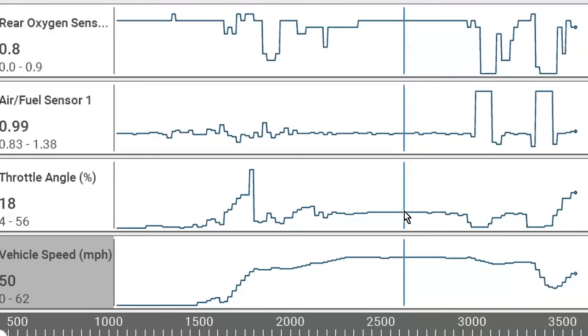So this 18% throttle angle, that is not accelerator pedal, that is throttle blade opening. So you see nice steady throttle the whole way, nice steady vehicle speed the whole way. In turn, I'm getting a nice steady air fuel ratio sensor. So that means everything's kind of working the way it should, 0.99 to 1. And then this is the one you want to look at though, the rear oxygen sensor. In this case, I'm at 0.8, which is almost full rich. So there's some oxygen left, but not a lot. So that means it's working,